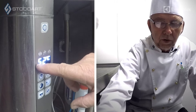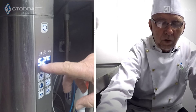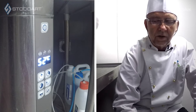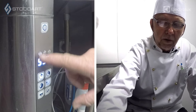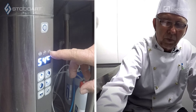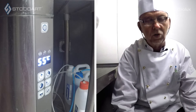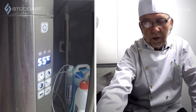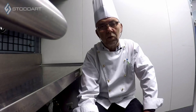What you see on the display presently is the wash temperature. So the wash temperature is 52 degrees — that means the water in the wash tank is at 52 degrees Celsius, which is ideal for your wash. So we're just going to press number one. That's going to start a 60-second cycle. It will then do a rinse following and the temperature of the rinse will then display. The little light above here, above the five, is indicating that this is the wash tank temperature that's displayed. The one over this side, when it goes onto a rinse, that will then illuminate, indicating the rinse temperature. The one in the center, the water tap with a cross on it — if that should illuminate, it means you've got a water supply issue, whether someone's turned off the water in the building or to the machine. Notice the light's jumped over here, so this is indicating the rinse temperature. We're rinsing at 87 degrees Celsius, which is very high. Electrolux machines are programmed to wash at 52 degrees Celsius minimum and to rinse at 82 degrees Celsius minimum.